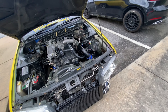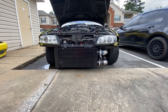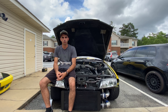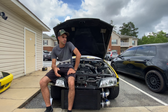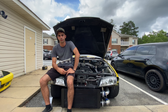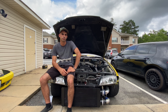But at least she starts up. The injectors are definitely not happy with this thing, but that's okay. With that front mount intercooler back on, I have to say guys, she's looking very mean. Depending on after the tune, how she's acting with the new MAF will really determine the next best move for this car. That 90 degree elbow — it's somewhere in the great unknown of my apartment. Depending on how the tune does and how this car is reacting will determine whether I keep it this way or disassemble the head, do a new head gasket, ARP head studs, new valve springs and valves and all the retaining clips. I would like to rebuild this head sooner or later, but that is not something that's very pressing at the moment.